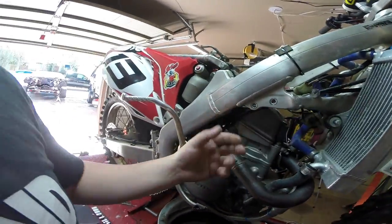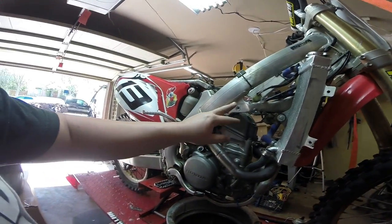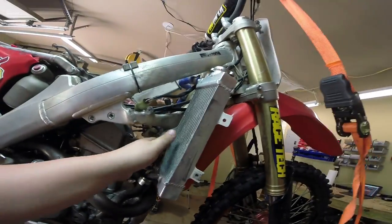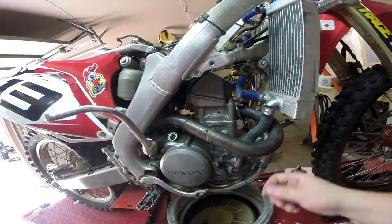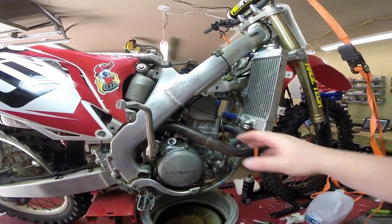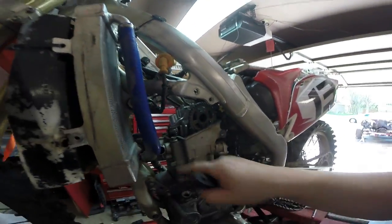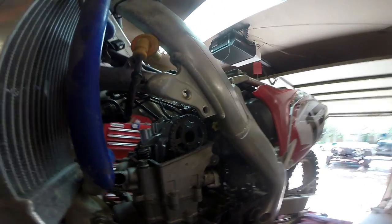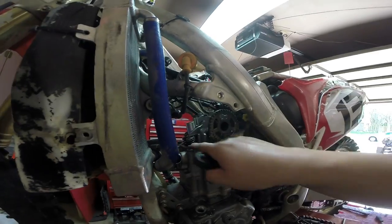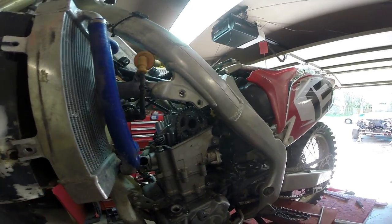I went ahead and took out — there's just three 12 millimeter bolts on each side that hold the head to the frame. You can see this bike's been laid down a couple of times. Now we just kind of got to start removing stuff off of the head to allow us to get these head bolts out. We've gotten all the coolant out of the motor, got the valve cover off — just two 10 millimeter bolts on top. And there's our unicam assembly. You got the exhaust valves right here, the intakes are down in the middle, and it's definitely hitting something.